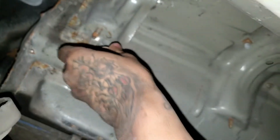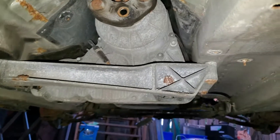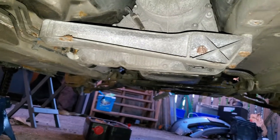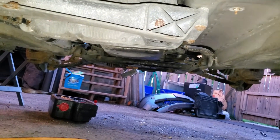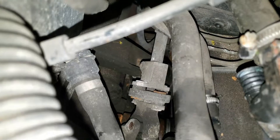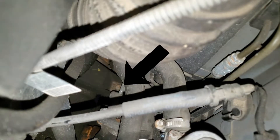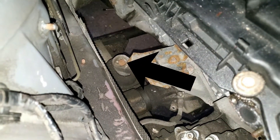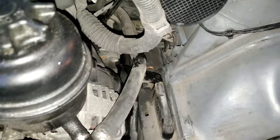The drive shaft is out and still on the diff, which is okay. Now we can take those bolts off the transmission, but we have to strap up the motor and support everything before the subframe comes down. Right behind there at the bottom there's a 16 mil nut - that's the motor mount there and that's a motor mount there. We're gonna unbolt both of those using a really long extension, swivel joint, and a 16 mil.